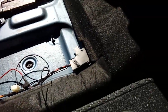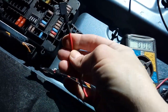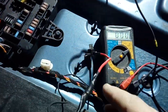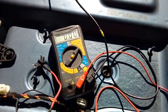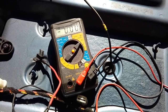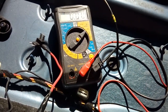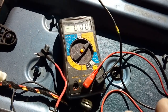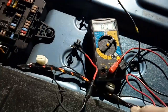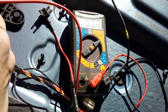We now need to figure out which fuse to use. The fuse spur is connected to the extension wire and we're at the fuse box. The cable is run up underneath and around under the padding, all hidden out of the way. Hopefully you've got some knowledge of how to use a multimeter, or you can use one of those little test probes that light up. With your ignition off and no key in the ignition, earth your test probe and we're reading zero — we're looking for a fuse that is also zero with the ignition off.